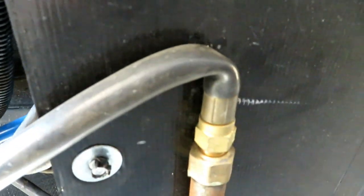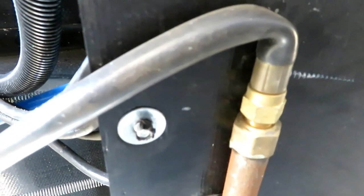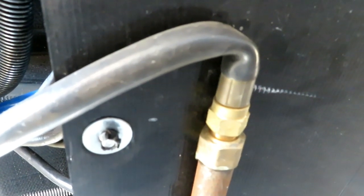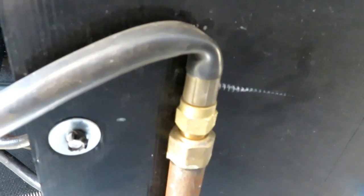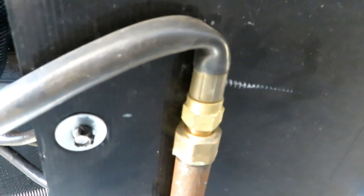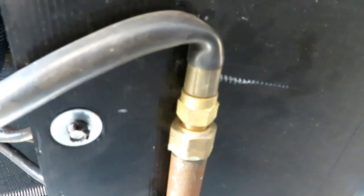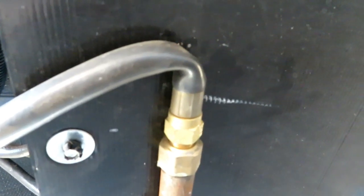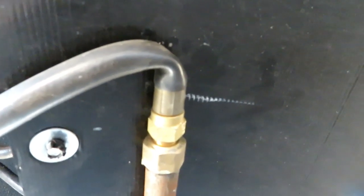Here's the gas line — it runs from the propane all the way up and back, and here is the kink. When the slide comes in, it kinks this line, and the problem is when it pulls the slide back out, it doesn't unkink. Or vice versa — it unkinks when the slide is in and then pulls so tight that it kinks when the slide goes out. Either way, it's kinked and it won't unkink when the slide is out.